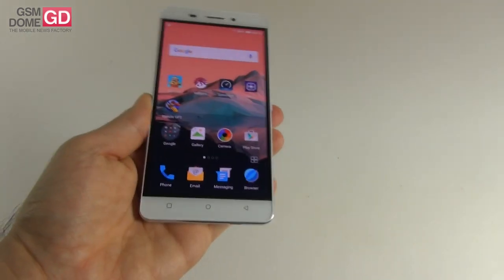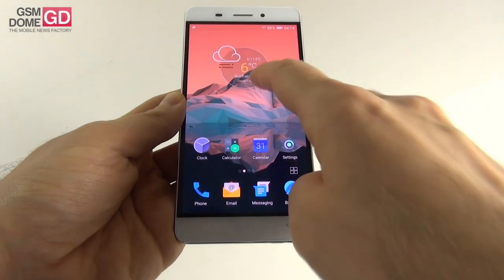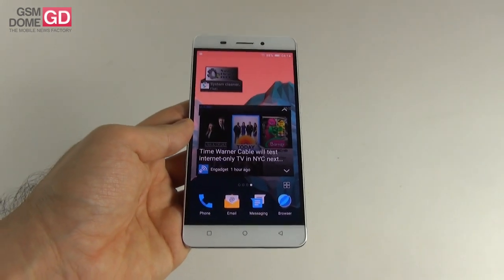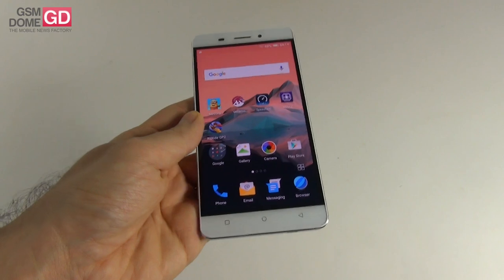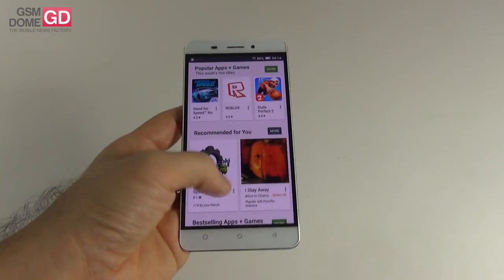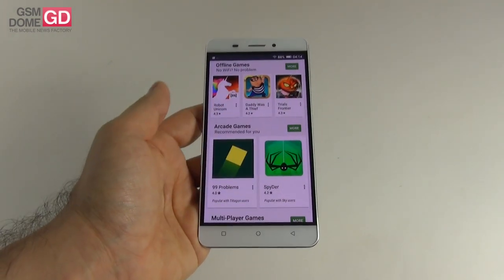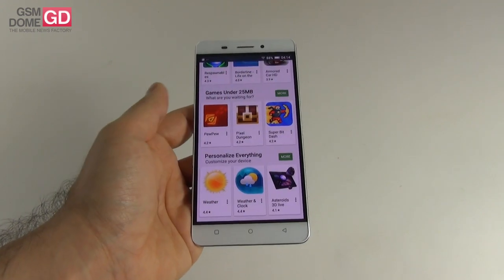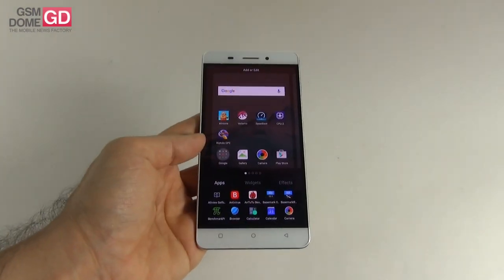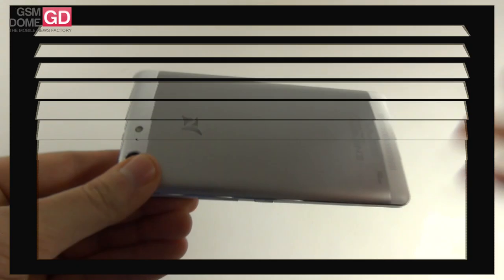This is a decent design for a phablet. As far as the hardware is concerned, the screen is a 5.5-inch AMOLED with OGS technology, resolution of 1280x720 pixels, and Gorilla Glass 3 protection. The processor is a quad-core MediaTek MT6735, a 64-bit unit clocked at 1.3GHz with Cortex-A53 cores and 28nm build process. It offers Mali T720 GPU, 2GB of RAM, and 16GB of storage with micro SD support for up to 128GB extra. Up front is a 5MP camera, and at the back a 13MP main shooter.